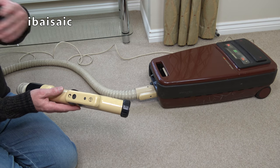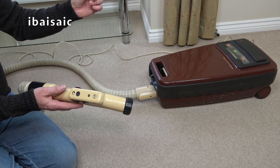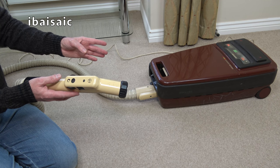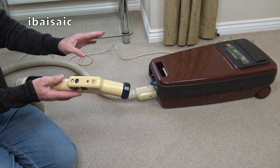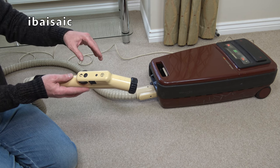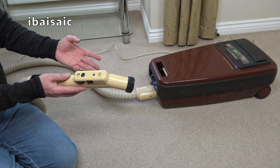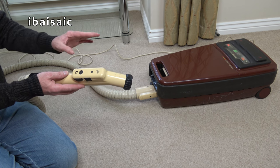Saying that, I'm detecting a little bit of a smell. Now, I don't know if it's my lights or it could be that nasty little suppressor inside there, which could be about to blow, right? This has happened before with my System 1. It seemed fine. And then when I changed the shot, you know, I moved the camera about and switched it on again, that's when it went kaput. I can fit new suppressors or bypass them. I do have some new suppressors, which I prefer to do with this sort of machine, just put a new suppressor in.